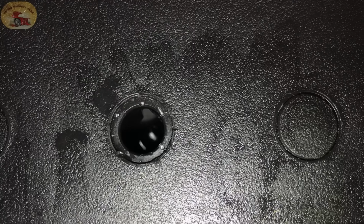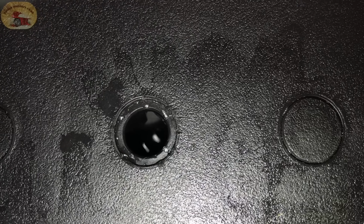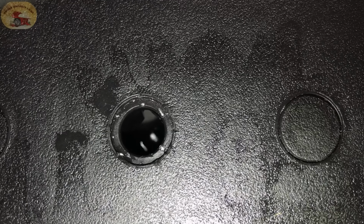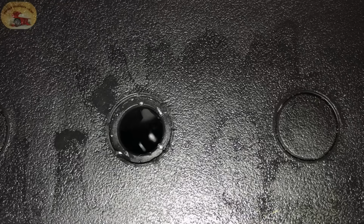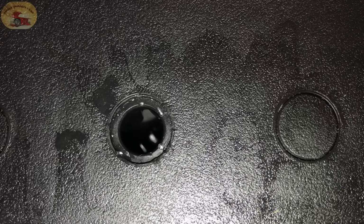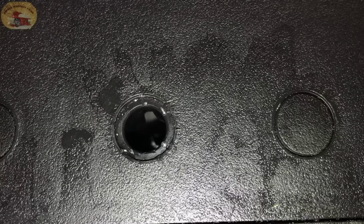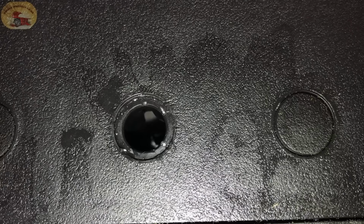After you've let it set 15 minutes, then you'll remove the battery charger from it, let it set for an hour, and do it again. You'll continue to do that 5 times, 15 minutes at a time. You'll see it bubbling and boiling in there, and you're not getting it too hot to damage the battery.